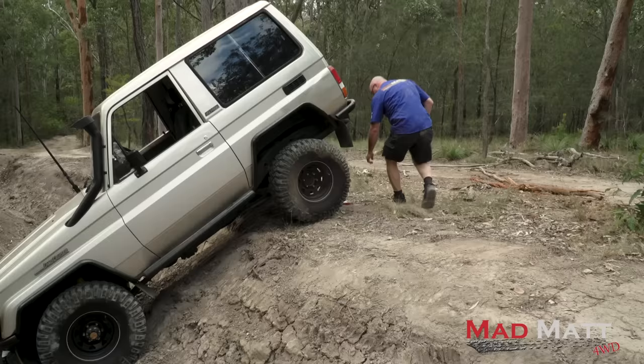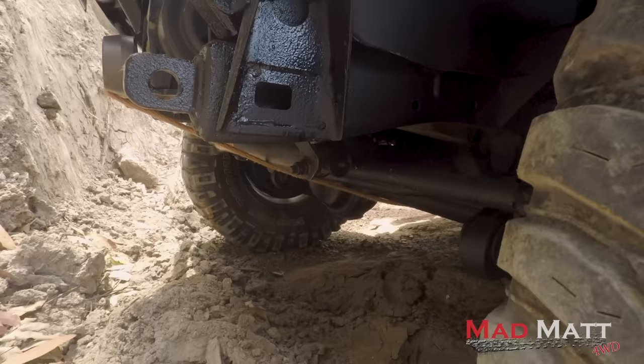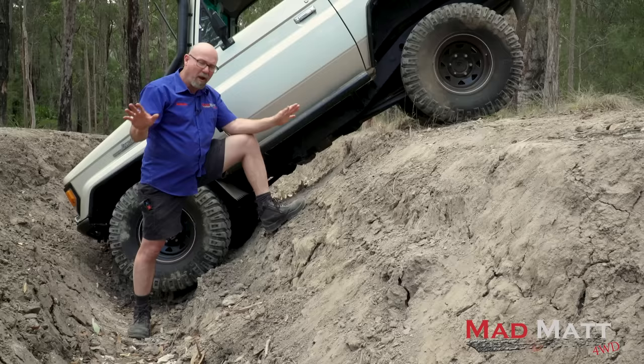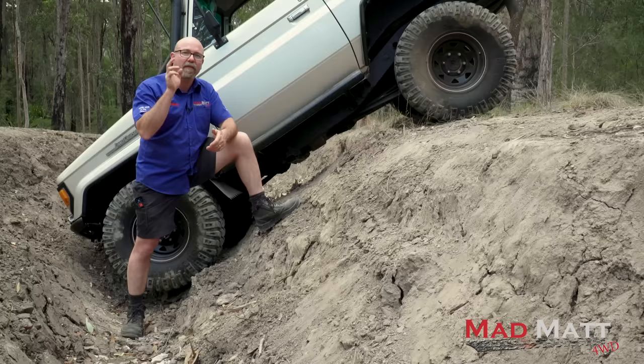What I'm going to do is take the winch cable and run it underneath the vehicle and out the back to that tree over there, and use the winch to pull me backwards. I need to give you a disclaimer - this could very well damage your vehicle, so you need to decide for yourself whether this is a procedure that would work on your vehicle. You could potentially bend your bull bar back, damage some items under your vehicle, or break your winch cable if it fouled on a bolt or another sharp edge.